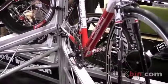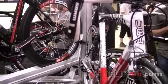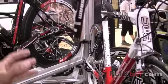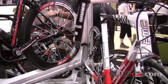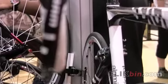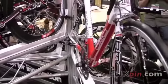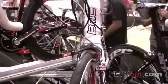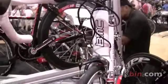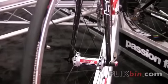We start with the Racemaster SLX01. We made some significant changes, for instance on the color white, to utilize the hybrid material mix more broadly. We're using aluminum on the lower part of the frame, and on the top tube we're using a carbon fiber called the carbon arc. Just newly towards the 2010 model line, we have a brand new full carbon fiber fork — carbon fiber legs, carbon fiber crown, and carbon fiber steer tube — which is going to bring down the weight substantially, less than 200 grams versus the fork we used in model year 2009.